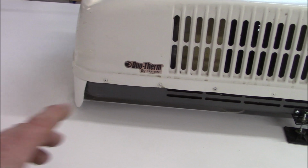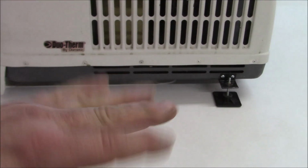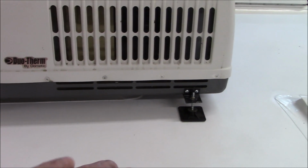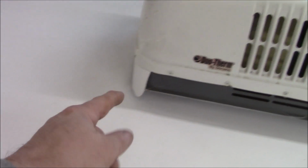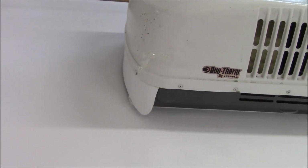I just don't want any water in there at all. So on the underside, if you were to feel it, it's got some bumps and ripples there, which will make the water kind of fall off in droplets. It's a water adhesion principle, but anyhow, it's unlikely that you'd get water coming in this way. But on the front, you could, especially if you had a blowing rain, try to force it that way. So that's why we put this front counter flash on here, and it goes up underneath the lid.